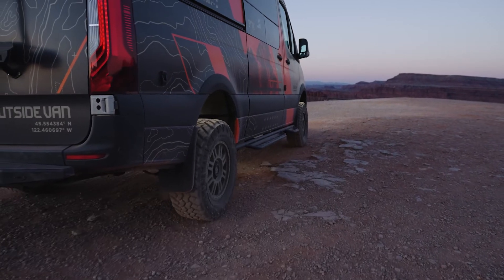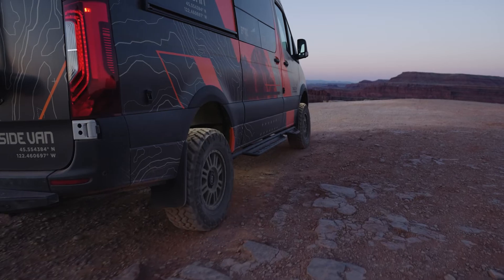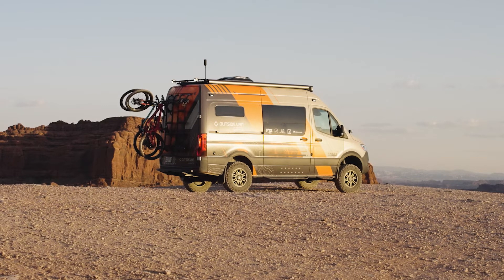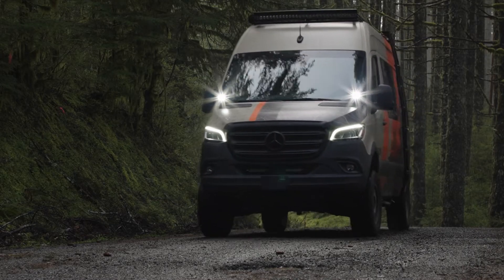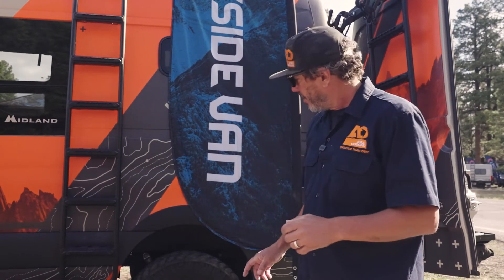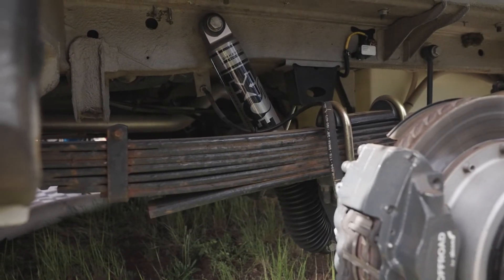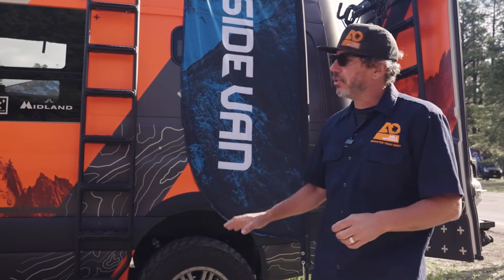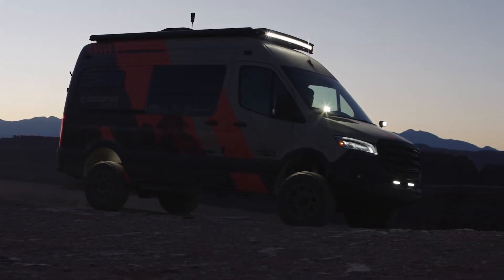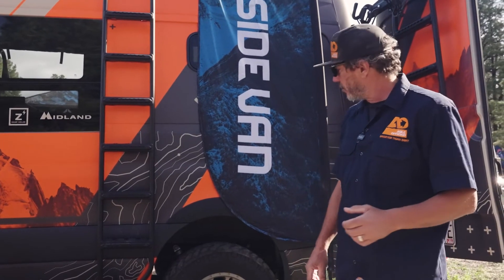In the rear, we're going to replace the rear spring and do a few other things, but primarily we're eliminating that factory geometry — getting rid of that three-and-a-half inch block. On the VS30 chassis, the 2019s and newer, Mercedes actually went to an even taller block to compensate for what outfitters were doing. This one has our standard 4700 spring, which is pretty common for this type of build. When you're trying to keep the van within gross vehicle weight and Mercedes specifications, the 4700 is ideal for the best ride.